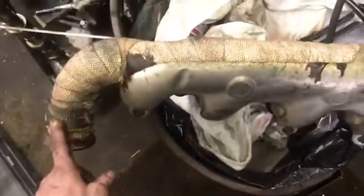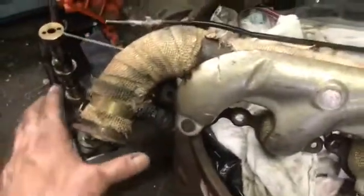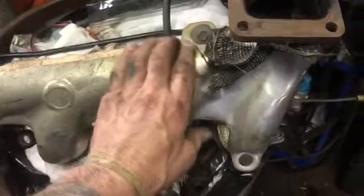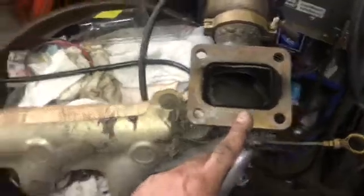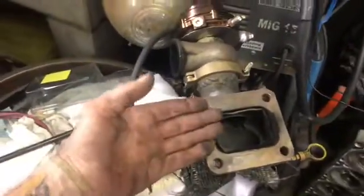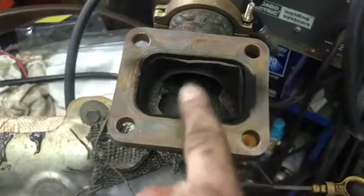Now I had a few questions on my wastegate placement and how it works, and I'm going to show you right how I got it in here. Okay, so crossover pipe comes in here. All of these runners are going this way, so this is all flowing together. Okay? It hits this merge here and then goes up to the turbo, where I place this at a perfect triangle. So the turbo is this way, the wastegate's that way. So it's a triangle point. It goes right, you can kind of see it right there, how it's a triangle in there.